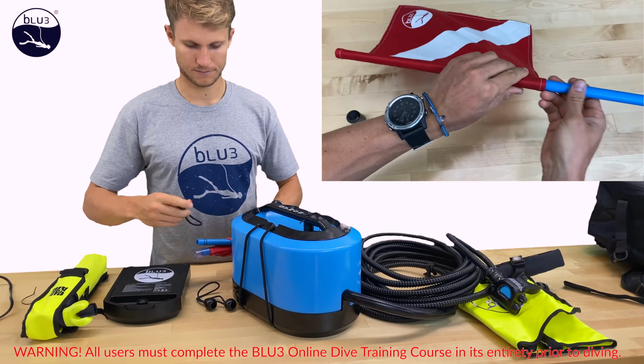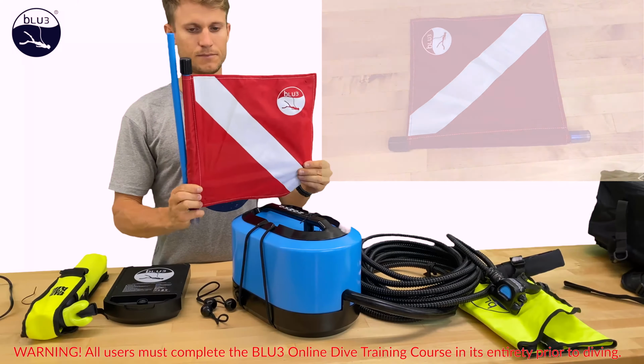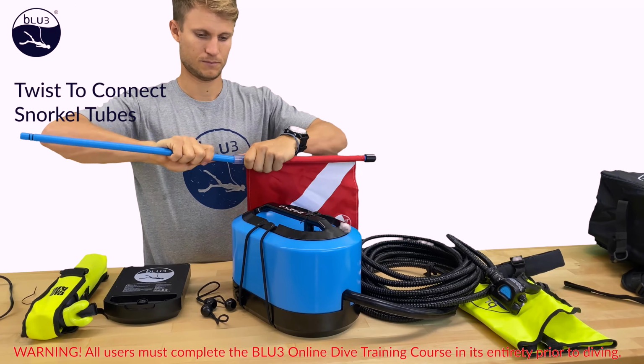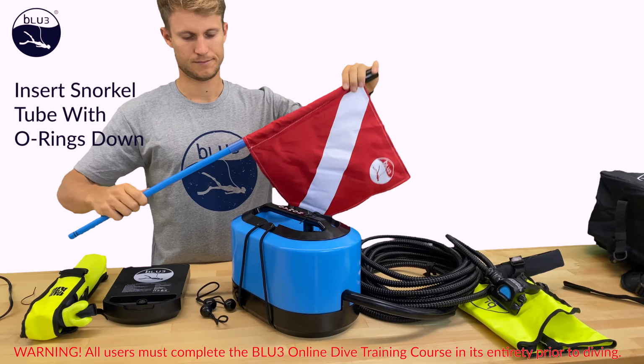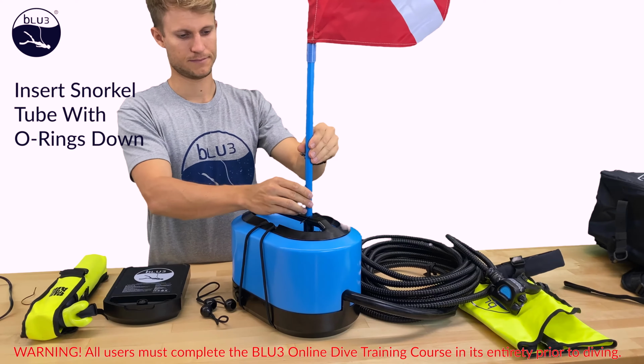Your dive flag should be installed on the upper half of the snorkel tube with the drip cap on top. Connect the 2 halves of the snorkel tube together by twisting into the union. Confirm that the 2 halves are completely connected and insert the snorkel tube into the intake of Nomad.